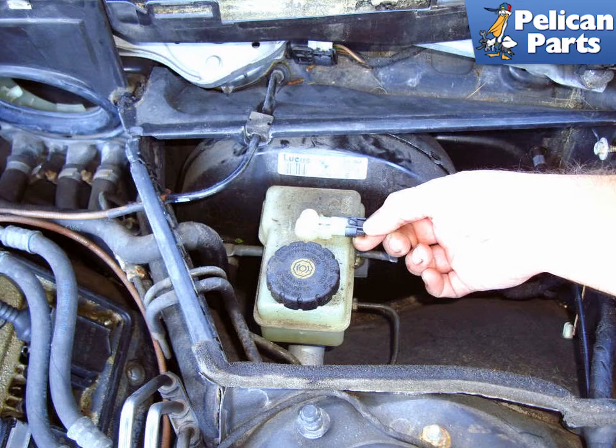This image illustrates the brake master cylinder reservoir on the driver's side of the engine compartment by the firewall. Unplug the brake fluid level warning switch by squeezing the locking tab on it and pulling the connector away from the reservoir. Open the cap and drain as much fluid from the reservoir as you can. Brake fluid is toxic to your paint so use caution.